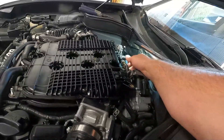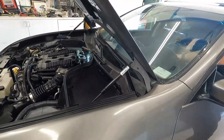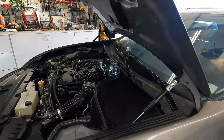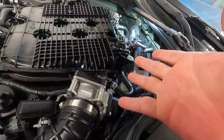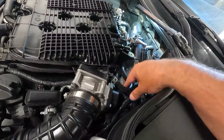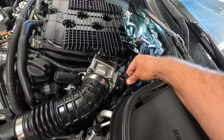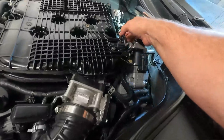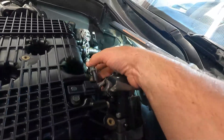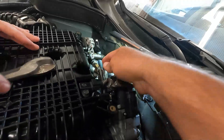Man, hopefully that's all it is. Let's turn it off, fix that, and then we'll clear this and see if it runs any better. I just immediately heard a hissing noise, and I just thought maybe something is loose or got pulled. He did have this throttle body off, and obviously that would have pulled this hose. It looks like this one right here completely cracked open or completely broke. Let's get some pliers in there and we'll get that fixed.